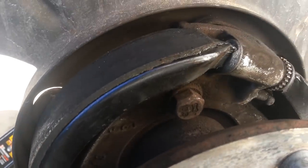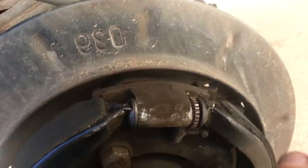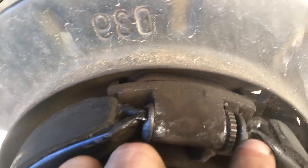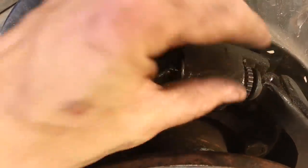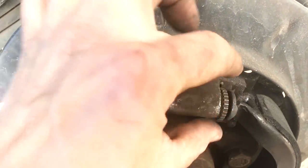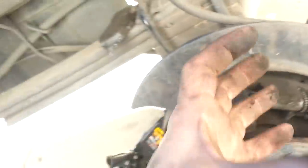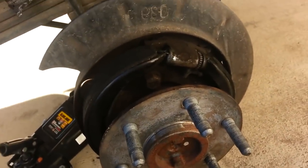Since I recently had mine changed, I just didn't fully adjust them. You can see there are two pieces on this side and a rotating assembly with teeth on it. I can spin this and it'll back the bolt out — this little bolt is threaded. As I rotate this, the bolt adjusts forward or backward, which actually changes the diameter of the horseshoe. That's how we adjust it. Right now it's still a little loose.